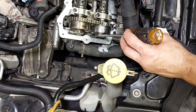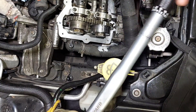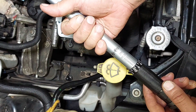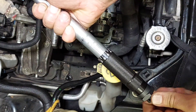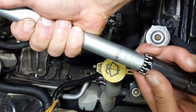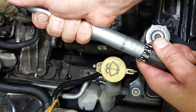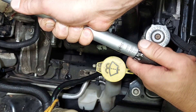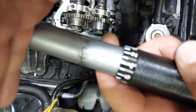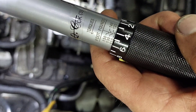We're going to torque that down — I believe it's supposed to be 116 foot-pounds, but I went to 114 since the first time I wasn't completely sure. I've seen it listed in a couple different places between 114 and 116, so I'm going with 114. You can see on the wrench: 100, then 110, then just past 114.